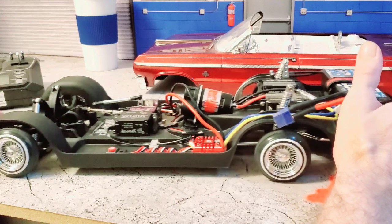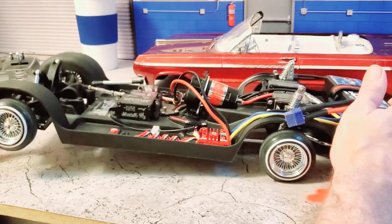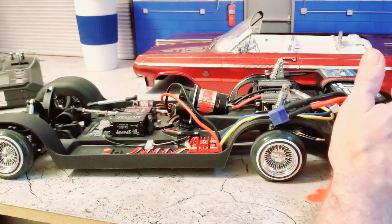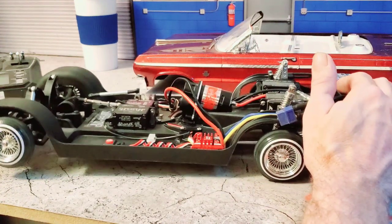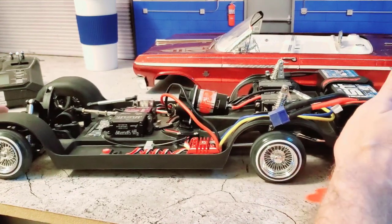So when it comes to gas hopping, if you have too much weight in the back, the car is going to tend to want to sit on the bumper and just drag the bumper. The nose isn't going to come back down. So having a very, very light back end really makes sure that the car doesn't stall on the bumper while gas hopping or just generally hopping at all.